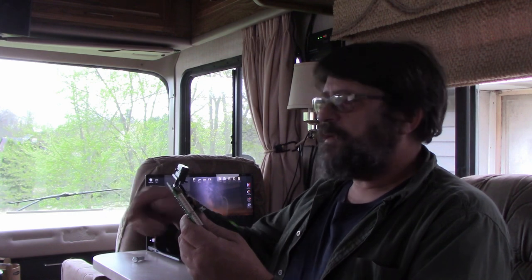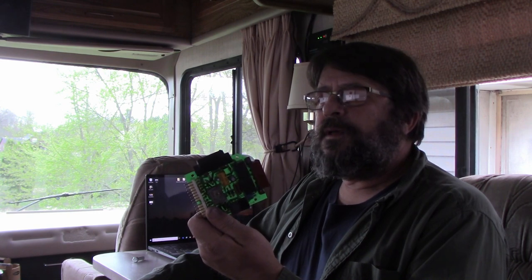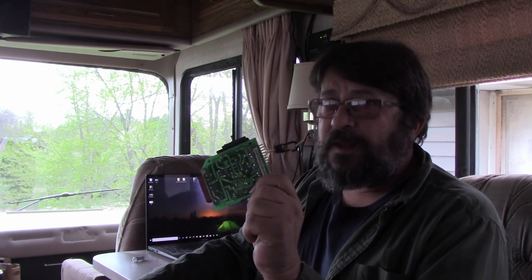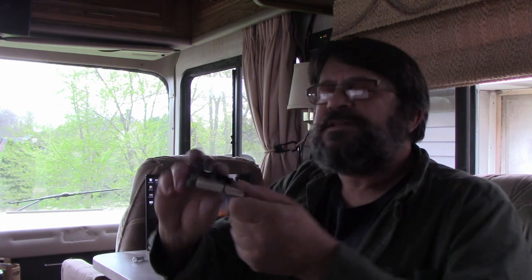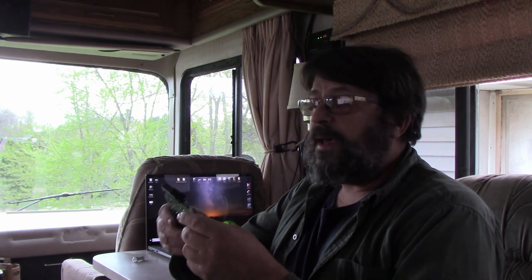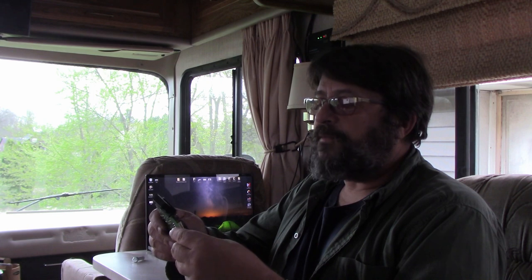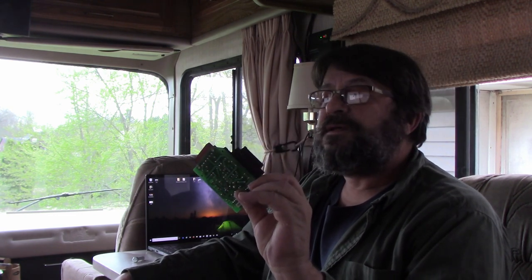The switches were fine. I was going to just take a gamble and just replace the board. Kind of rolling the dice, not knowing for sure that's what was wrong. I suspected that's what was wrong, something on the board, because it has these little resistors and relays and stuff on it. I suspected something was wrong with this. And had I bought the board, I found one on eBay actually. There's a supplier of remanufactured parts, and they were $149.99 for a new board. And I bought it and replaced it. It would have fixed it.